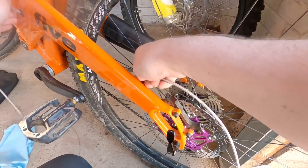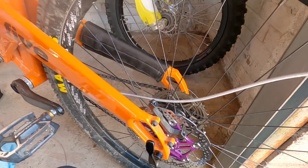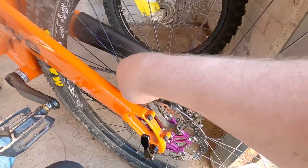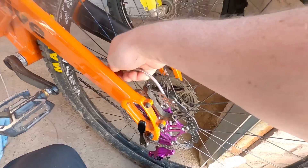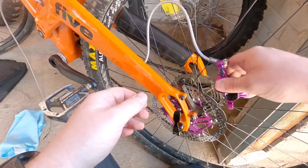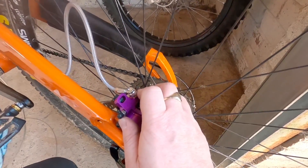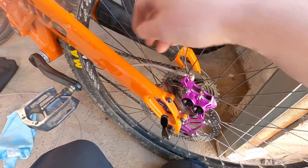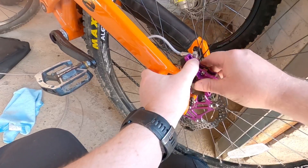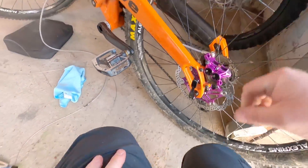It pushed out through the other side, so we're all clear. It's just a case of feeding through the rest of the cable now until you get the caliper near the mounting point. Then you just make sure you've got enough slack so that you can mount it without having to pull through as you're tightening any screws. It's starting to take shape now with the caliper there ready to be mounted properly. I'm not going to put any screws in yet — I'm just going to feed everything through, feed it up to the top and then start connecting the lever.